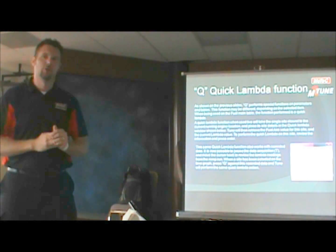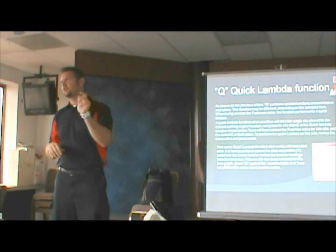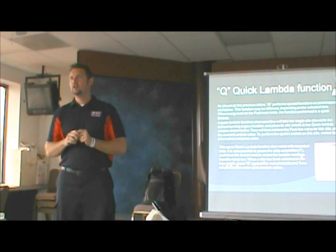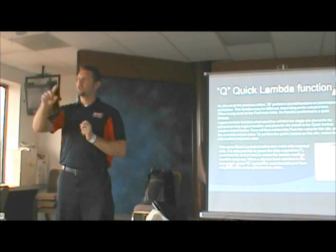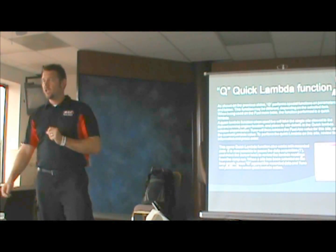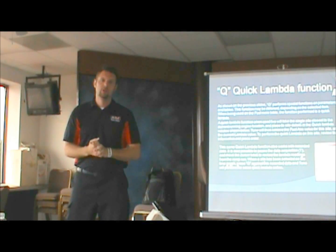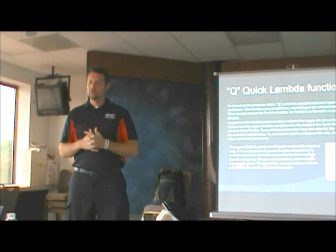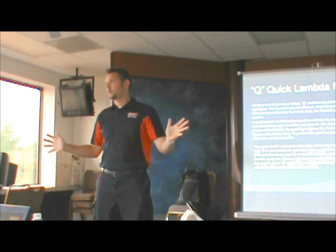I can explain that in more detail if somebody has a question on it. The neat thing about it is there's just a one click correction on the keyboard. You can just sort of go through a sweep and click this one key, and it'll correct everything as you go along. It can be done live during a dyno pull if you want to. I've had some engines making 2,000 horsepower that I tuned from scratch.